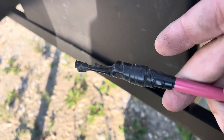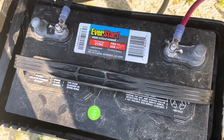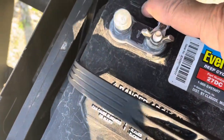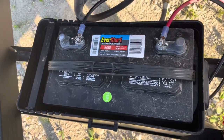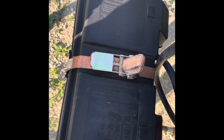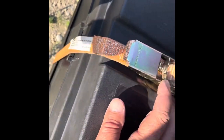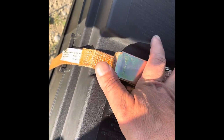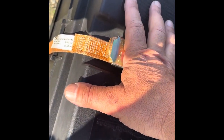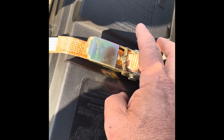You have to remove this tape off of the red wire — red is positive and the black wire will be negative. Battery is hooked up: red on the positive, black on the negative. Go inside the coach and make sure there are no lights on — a little wear will drain your battery. Got the lid secure, got the strap securing it. Make sure you go over the bracket. I use the orange straps. I've heard DOT is looking to make sure the battery is secure, so I want to make sure when I go through a weigh station they can see that it's on there.